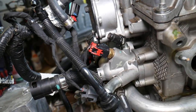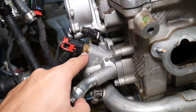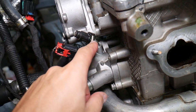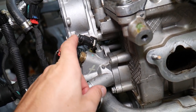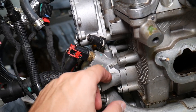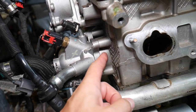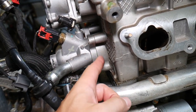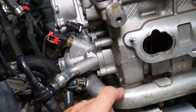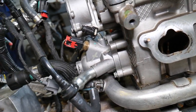You can develop a leak from your coolant temperature sensor if it's not installed tight enough — that's a weak spot. This pipe coming from the coolant overflow bottle is a plastic pipe that cracks often, so you can develop a leak right there very easily. And there's the thermostat housing gasket — it's an O-ring — that one I've seen develop quite a few coolant leaks as well.